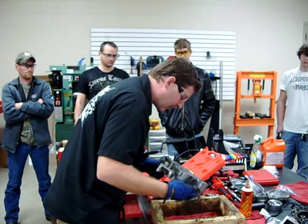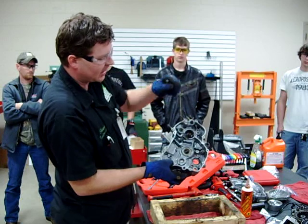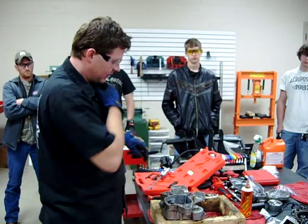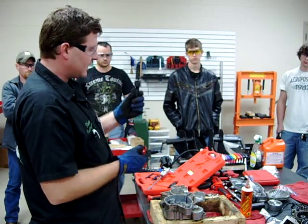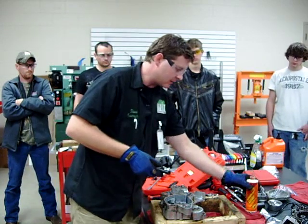This particular one we could actually drive out from this side, but for demonstration purposes I am going to use the slide hammer to remove it. So I've got my retainer removed and I should be able to slide this in. What do you think we always want to put on this? Some grease — I'll use some assembly lube for right now.